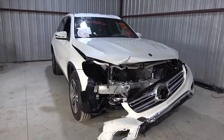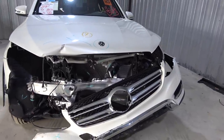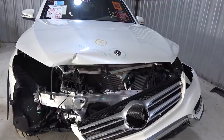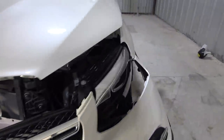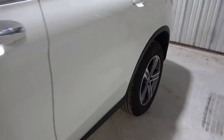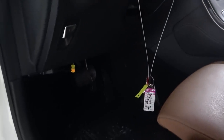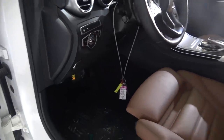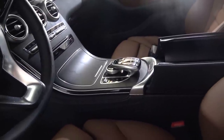Today's goal is to pull the entire front end apart and see how much damage we have. This hood I'm definitely going to save — it is steel, so not too much work. On the interior we have two deployed airbags: the driver's and the knee airbag. I pulled them both out and ordered the driver's side airbag already. The knee one I can't find at a decent price. The center console needs to be pulled today because we need to find the airbag module.